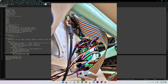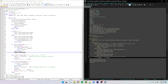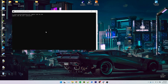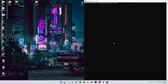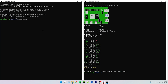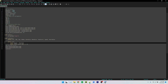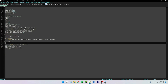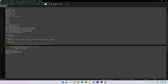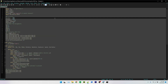Now that I have all the components for the Raspberry Pi installed, it's ready to be programmed. I'm using Python because it's a relatively simple language and it's really easy to grab data from the GPIO pins on the Raspberry Pi. For right now it is button-accelerated because I don't have a variable throttle input. It's basically going to accelerate a set amount depending on what mode you're in. So if you're in mode one it's going to accelerate slowly, which is going to help me with cogging since this 12S ESC still isn't sensored.